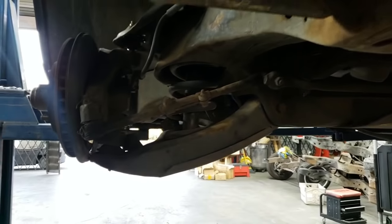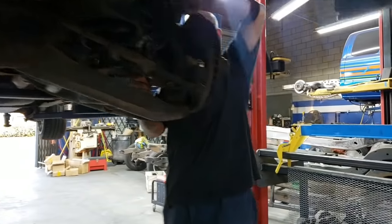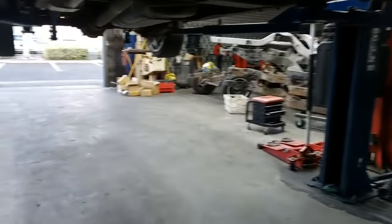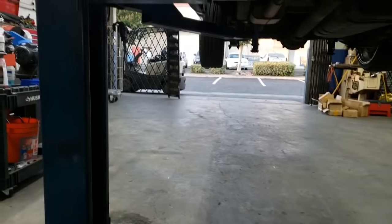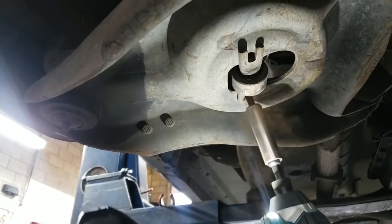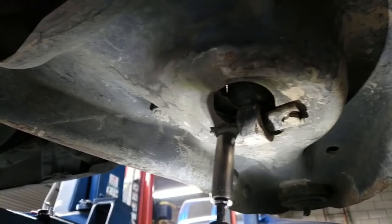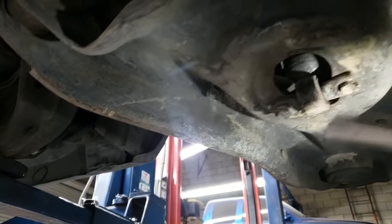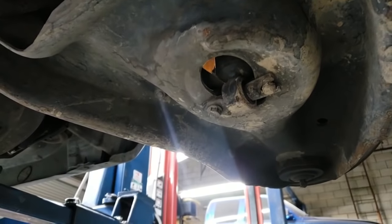Normally when you're working on one thing you just do the other side too, since you already have the tools in your hands. We got the plasma set up — we're just going to plasma these coils out. In the meantime we're going to work on the bottom side — take out these two shock bolts, which are just half inch. We're going to repeat that over for the other side. Looks like someone replaced these bolts at one point and there are nuts on the top side, so we're going to have to hold them in place up on top and remove this side.